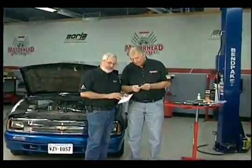Now we got 150 pounds of compression on all 4 cylinders. That's real even. A little Xado motor is pretty good. It's consuming a little oil, smoking a little bit, reading the plugs. Probably got some scratches on the cylinder in number 1 cylinder. Could have a valve stem oil seal that's leaking.